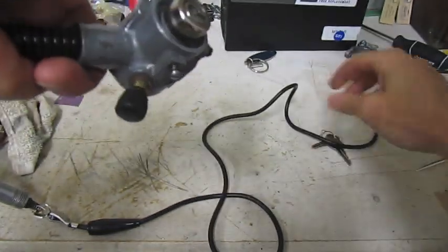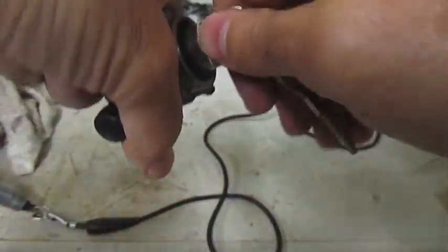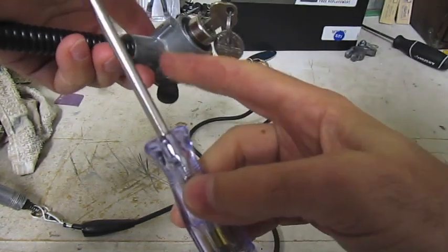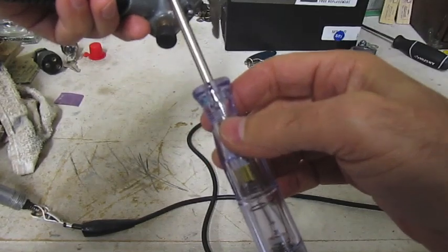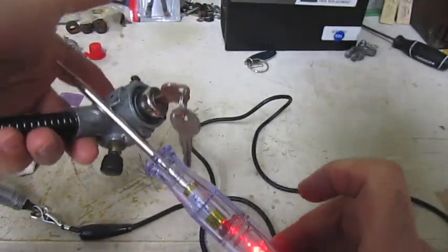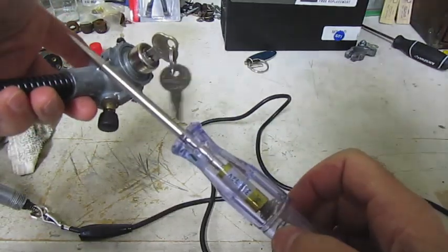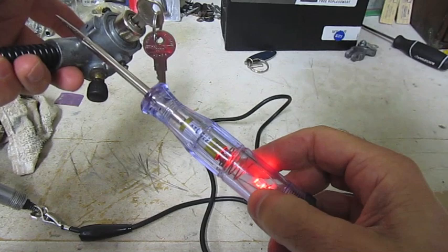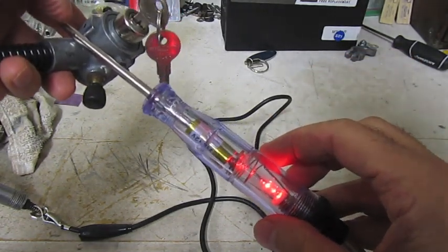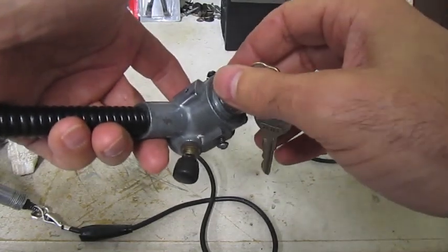The second test is on the body. The switch has this body here, I think just made of stamped metal. The switch is off — it's pushed in. The test here is the test light on this body. You should have a connection when the switch is off, but not when it's on. When I put it on here, the light should go on — and it does. Now we're going to put the switch on, popped out. The test light should not come on if I put it against the body; it should stay off. But what I'm seeing is I put it on the body and sure enough, the light is on. I think that is a problem. I'm going to find out for sure, but it looks like I'll have to send this back. In the meantime, I'm going to use an aftermarket switch and ignition cable until I get this resolved.